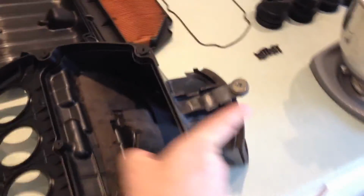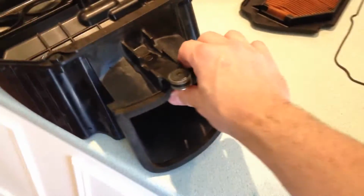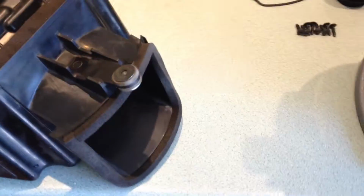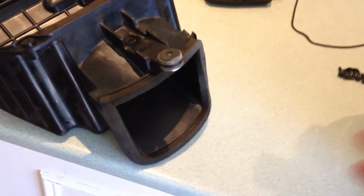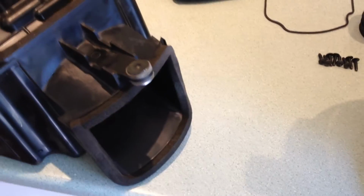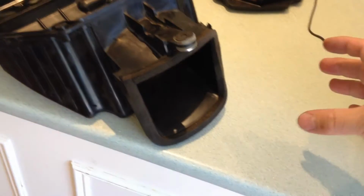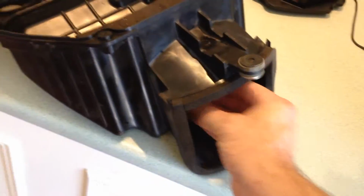So the air comes in this direction. This is where the motorcycle is traveling, in that direction towards the kitchen mixer there. So everything that comes in the pathway, the engine just gulps in through this opening here. Little sand grits, rain is not clean, so all the water that falls down, the wheel wash from vehicles, everything is channeled in here through the frame, and between the two headlights on the motorcycle there's an opening there, so everything comes through here.